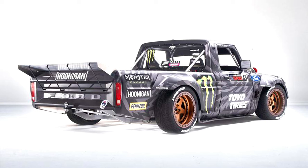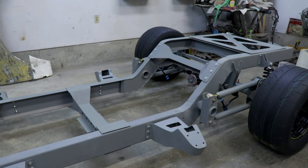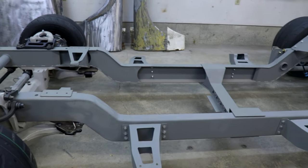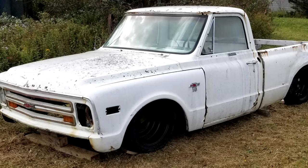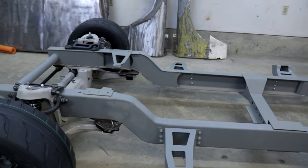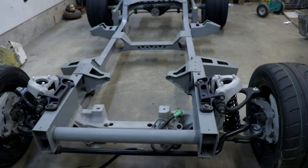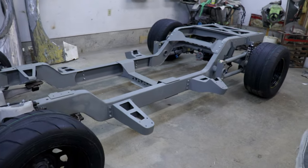Looking at Ken Block's truck, I got some inspiration from there too. After I got my inspiration and a clear vision of what I wanted, it was time to physically start working on the chassis. The way I started was by using two measurements I knew from the get-go. The first was my wheelbase — I knew I was going to use 111 inches. I found that number by mocking up the truck, marking where I wanted my wheels, and measuring wheel to wheel. The other measurement was the width between the two frame rails, which was determined by the Crown Vic front crossmember I wanted to use.